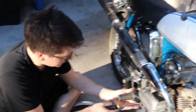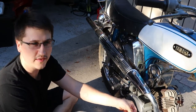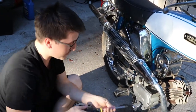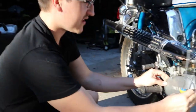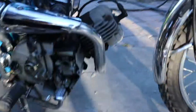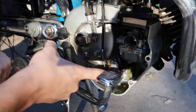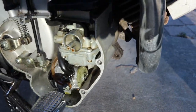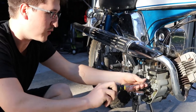It's kind of fun to fiddle with because I personally have never worked with any kind of carburetor, and this one's got a very unique system because you don't have to mix the two-stroke oil together. This tank is actually the two-stroke oil, and you just fill it with fuel. There's a pump in here that actually mixes them together right before it gets put into the engine itself. We have a service manual, but it doesn't say anything about adjusting it. There's your carburetor, and here's the actual oil pump. When you kick it, this actually spins. But it's getting way too much fuel. We've been fiddling with this for the past couple days, not really knowing what we're doing.